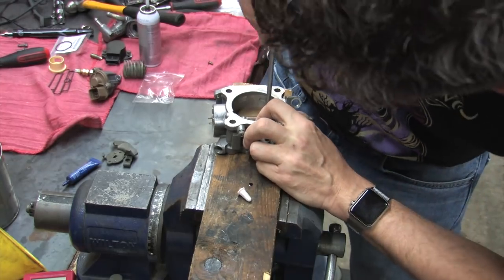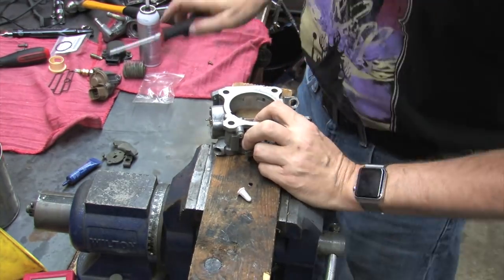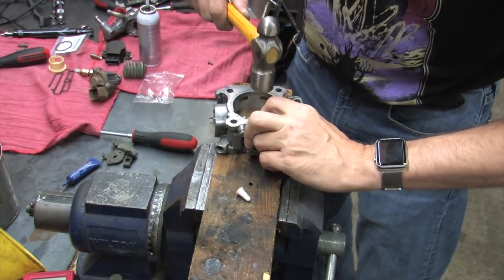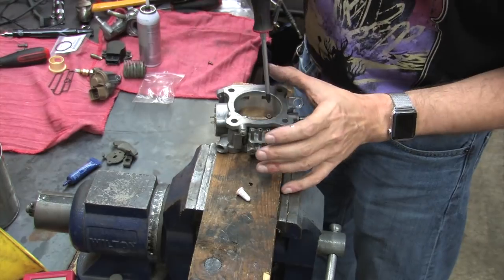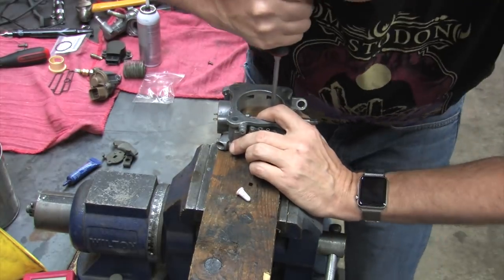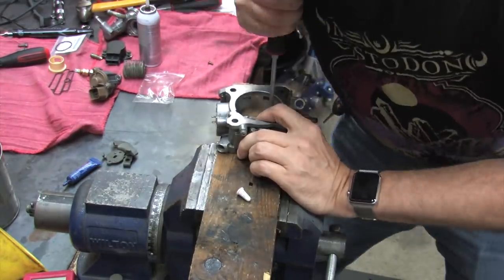Hey, things happen. If that happens and you distort the screw head, you can tap the head of the screw to flatten it out and reshape some of the damage into something more useful by hitting it with a ball peen hammer. The screws are fairly soft, and if you're not mashing hard while turning, it's easy to slip and strip out the face of the screw, so really lean into it.